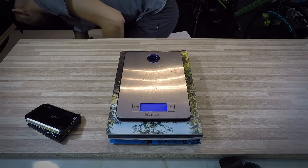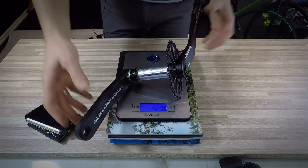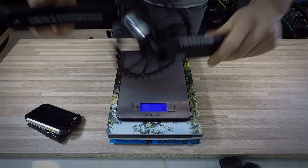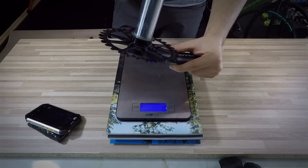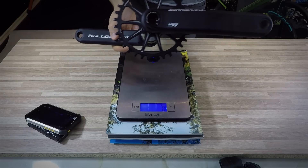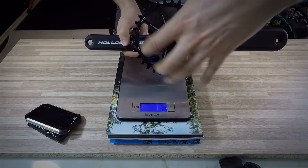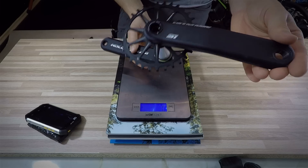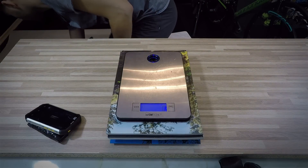Then something really exciting — that's the Cannondale Hologram SI crankset, 32 teeth. We have 511 grams in the front. I really love this crankset. What I wanted to share is that Cannondale allows you to remove the lock nut and turn around your chainring, so when it wears down from your pedal stroke you can simply spin it around a little bit and prolong the lifetime of your chainring. Super stiff piece of crankset — absolutely awesome.